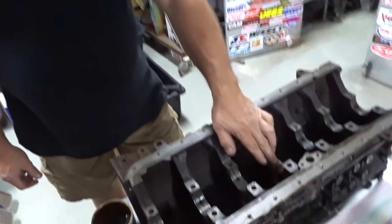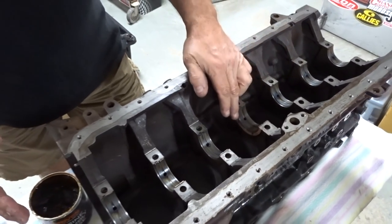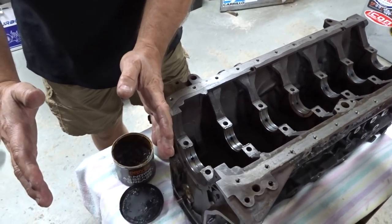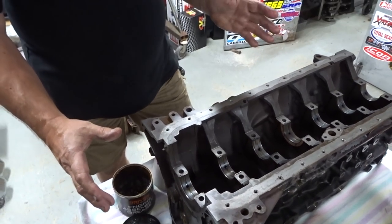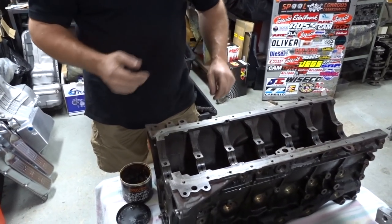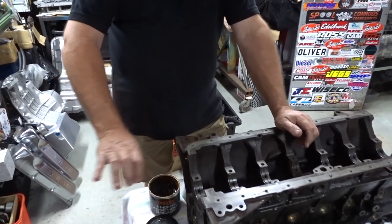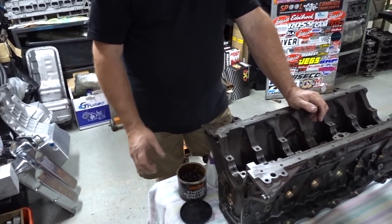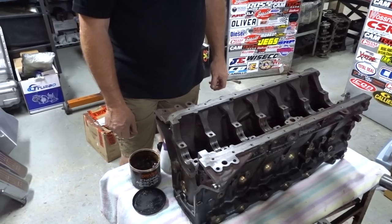So the oil will come from here, it will spill over the side and run out of that groove and fill that face. All your load from your clutch is pushing on the back. You see some motors where all this is chewed out. Sometimes what happens is there's a lot of load on the clutch - there's no free play on the slave cylinder or push rod or something like that, it's constantly loaded, so it's as if their foot is on the clutch all the time. It'll push on the crankshaft and damage the thrust face. I've seen that quite a bit. I've seen a lot of problems with the slave cylinders that are mounted over the gearbox spline - they run a spring to return the thrust bearing, and it seems to put load on the crank. So we're going to look at how to measure the thrust.